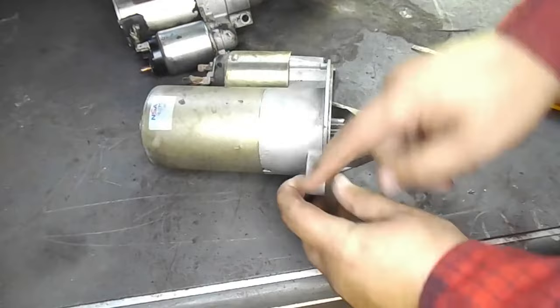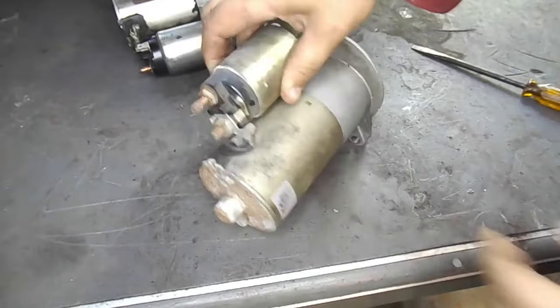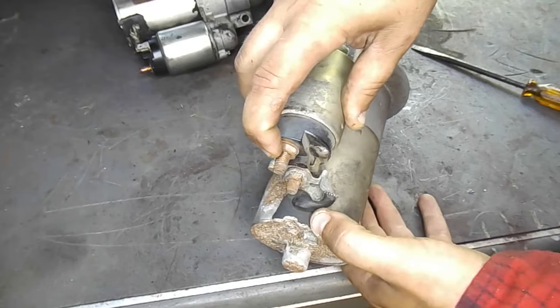The ground on the starter is your engine block, with the two mounting bolts that run through the starter into the engine block. Before even starting this test, make sure to inspect each post very closely for corrosion. Clean each post with very fine sandpaper and clean the wire going from the solenoid to the starter if corrosion is found.